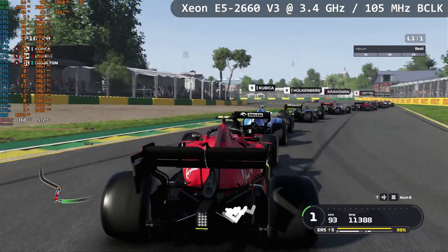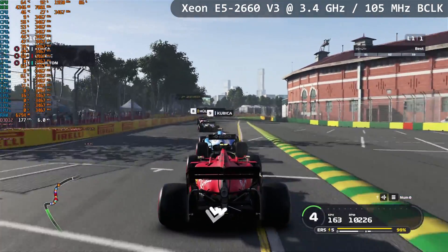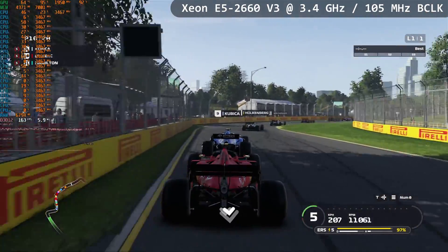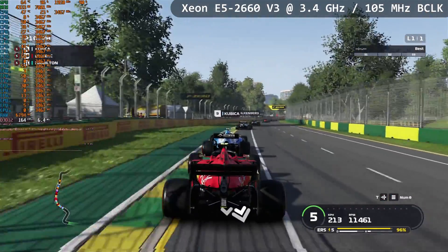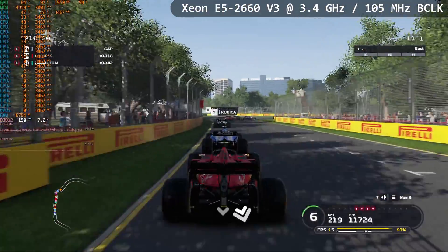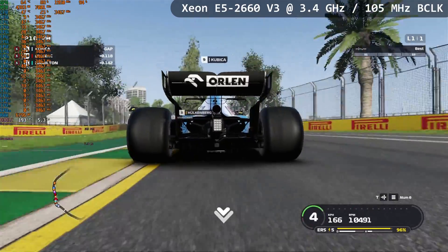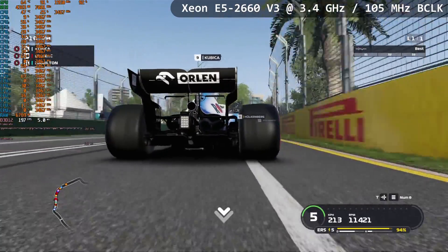That's why in this video I'm going to tell you how to unlock Turbo Boost on your Xeon E5 V3 CPU using the BIOS only. So instead of the manual EFI driver installation at the system level, the driver will be injected into the BIOS itself. Then you flash your BIOS to the motherboard and Turbo Boost is unlocked once and forever.